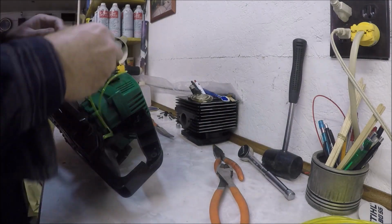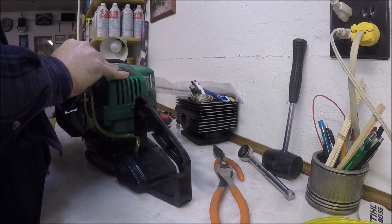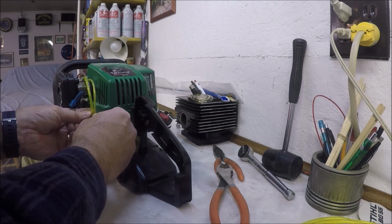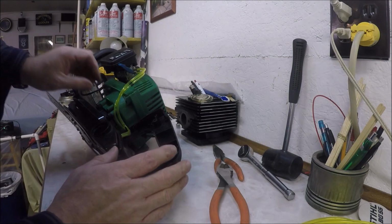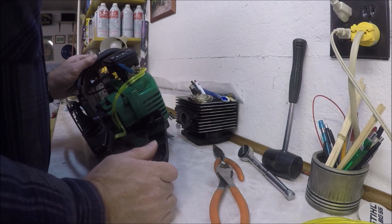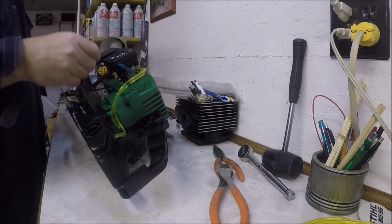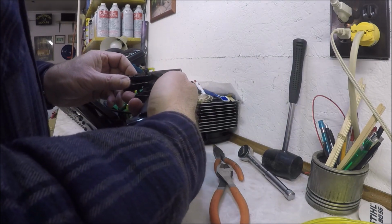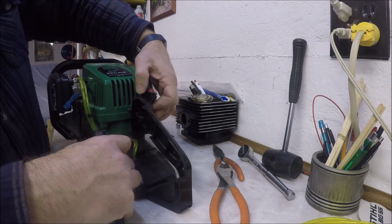So then we slide this guy up onto this top one. We have this little clamp, so we'll snap the hoses in, like so. I have both of my new lines on, and what we have to do now is put the handle back together. So first things first, let's take the throttle cable, reattach that. And then I gotta get the switch back in there.